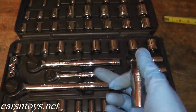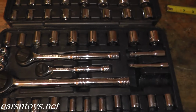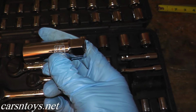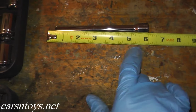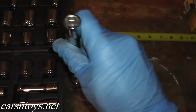This is a Harbor Freight 64-piece socket and ratchet set. I'll include a link in the description box below if you're curious about this set. It's a nice set to have. I actually keep this in the trunk of my car. But this is the socket that you want to have to remove the spark plugs. Also, you need an extension. In this case, I'll be using a 6-inch extension. And we'll go ahead and get the spark plug out of there.